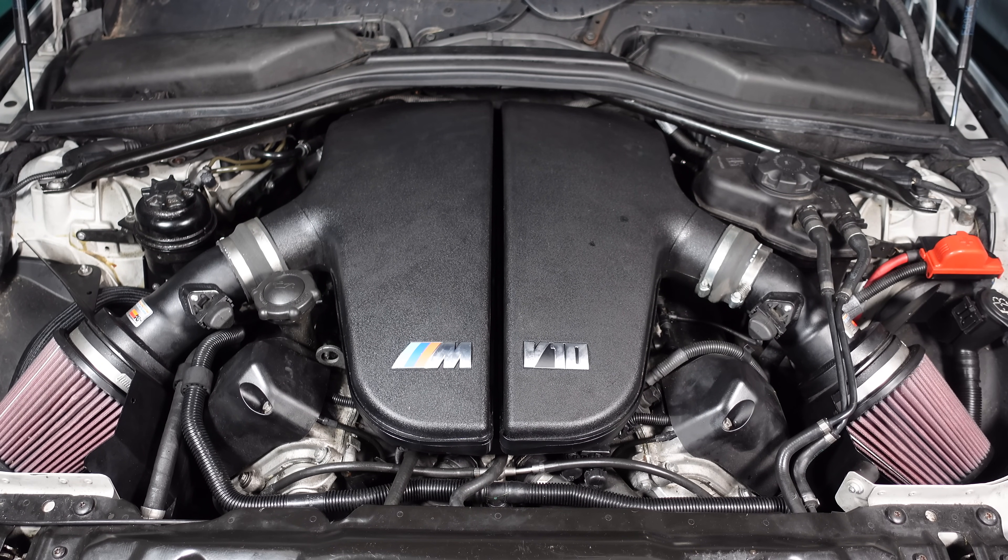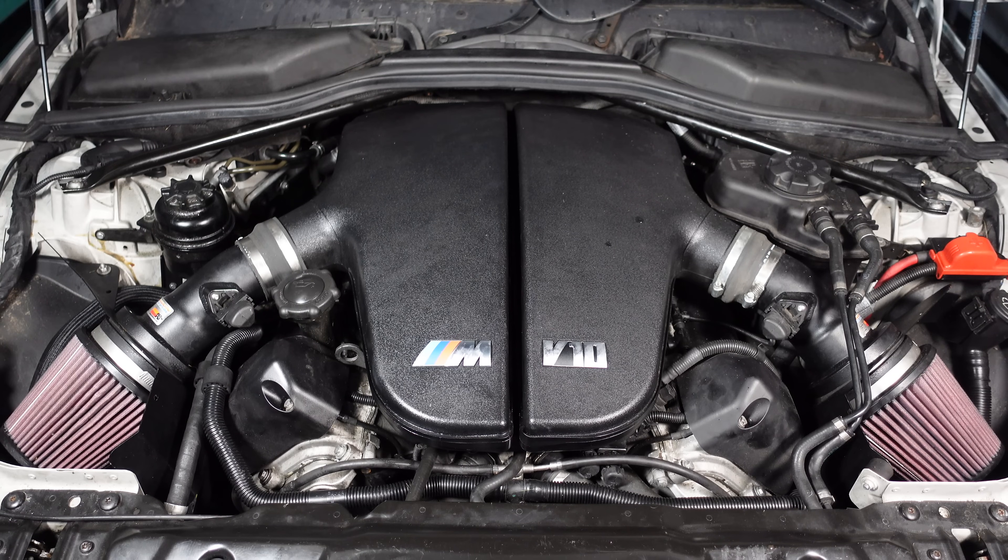All the smoke was condensation build-up from the rain and cold here in the UK — a lot of rainwater underneath the car on the grass — but as you can see it's all cleared up. I also used a lot of silicone on the intake plenums. Apart from that, the car runs absolutely beautiful. If you listen carefully you can hear the vanos adjusters — they're a bit noisy. That's purely because I need to bleed the vanos system. The oil isn't properly around the solenoids yet, which is causing that vanos rattle. I'm going to be bleeding the system to fix it.